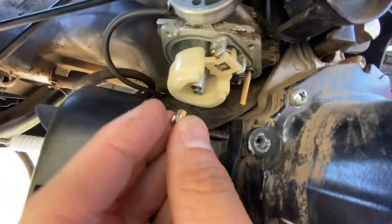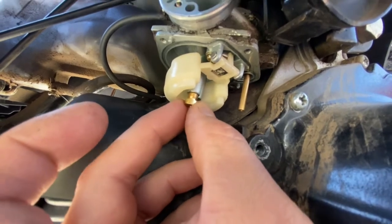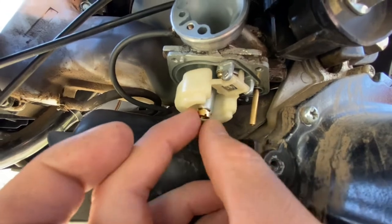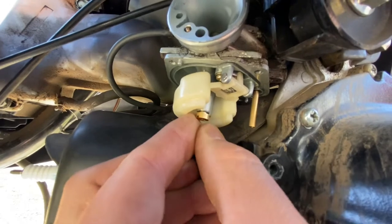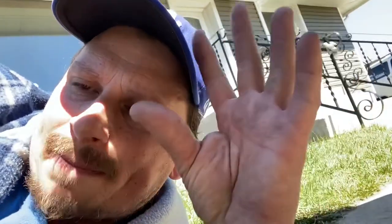There we are — we just screw it right in there, no big deal. This is your main jet. Some carbs have another jet you can change — an idle jet — but when you're doing the 70cc upgrade you just don't worry about that one, it's fine as is. Tighten that with a screwdriver. If you had some kind of big bore kit at 120cc or something, you'd have to go a lot bigger — call the store and they'll give you a guide of what to put on. But in our case, and most 70cc kits, about this size is what you need.